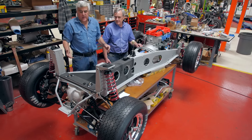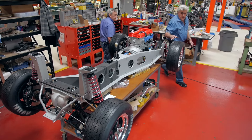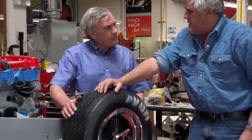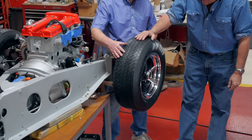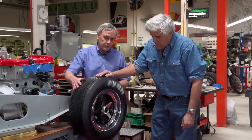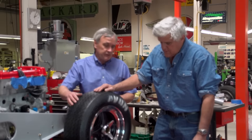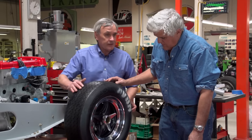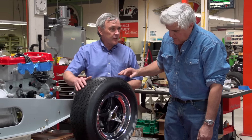I just wanted to show what we did with the wheels. Come around here. As you can see, Jim has painted the centers. It looks black but it's actually gray. On the original race cars, the wheels were magnesium and would have just been dipped this color. Since this has got to live for a long time without changing tires, we went with an epoxy to seal them up. And then Dirk, our polishing meister, worked really hard getting this magnesium polished up like a mirror.